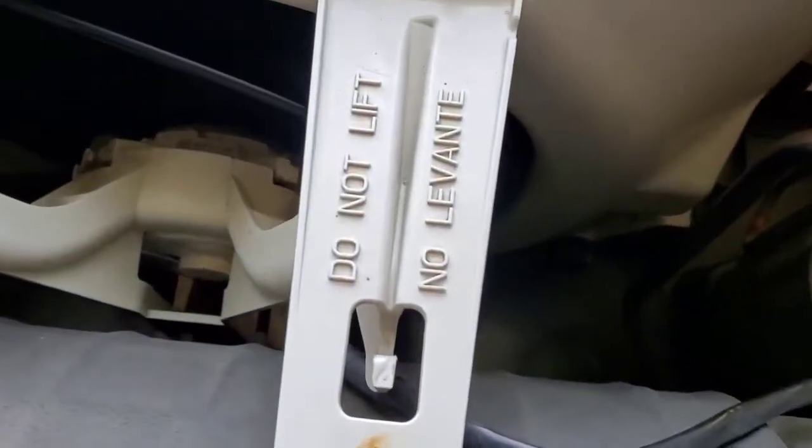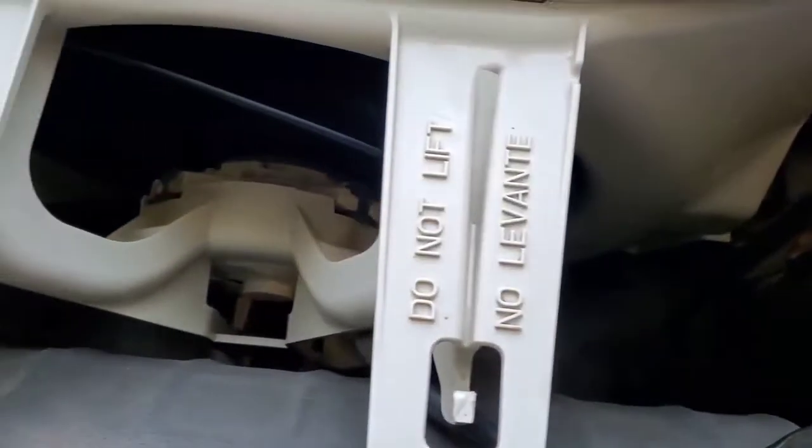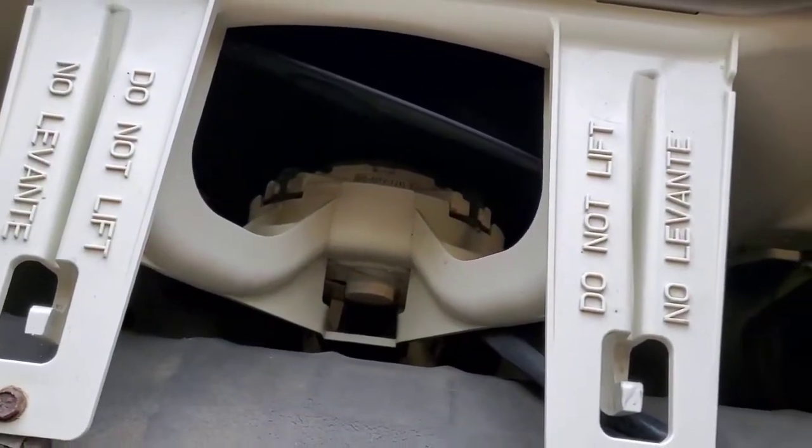What's going on everybody? So I got the GE pizza unit that's not cooling. Got the compressor running but the condenser motor is not working, so I'm gonna go ahead and change it out.